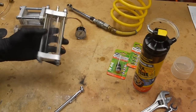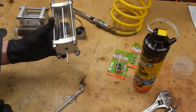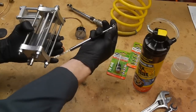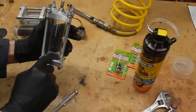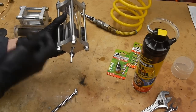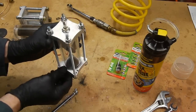To simulate a puncture, let's say you're driving along and a ten-penny nail goes through your tire. Interestingly, the simulated tire is still holding pressure — still close to 35 PSI — because the nail's surface is smooth and the rubber seals around it. But if the nail is still attached to wood in the road and just punctures then pulls back out, now we've got a real leak, and you can even see the puncture if we look closely.